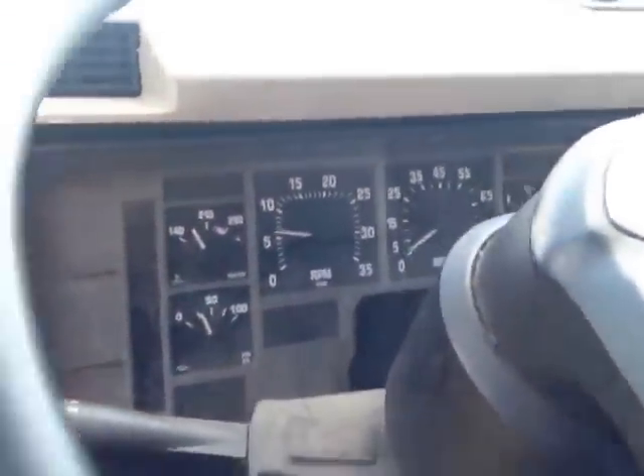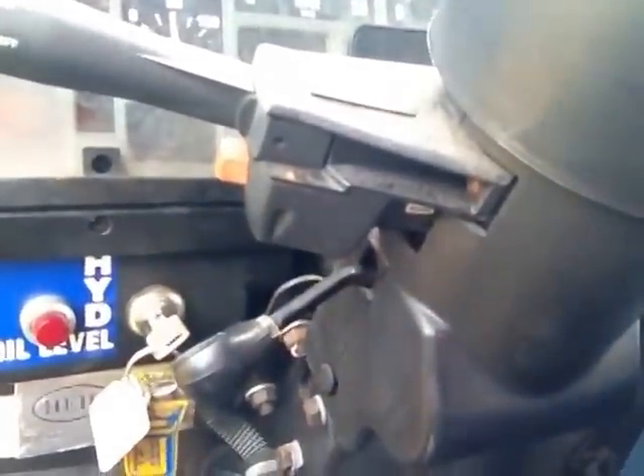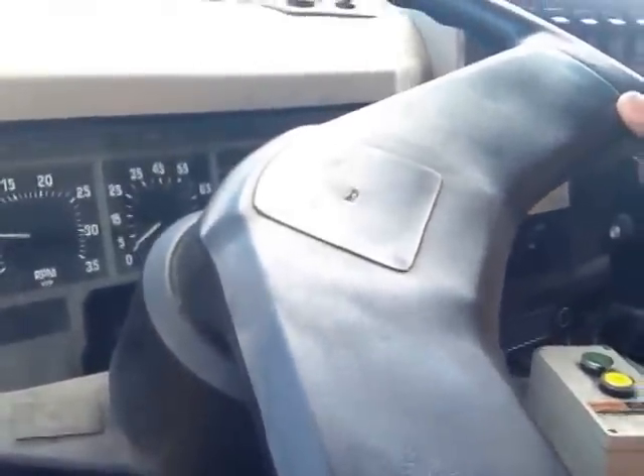Engine brake on — let's give her a rev. RPMs are up, now I let off the throttle — boom, then it kicks in. Now let's go over that clutch switch. So let's say I'm in gear — it won't kick on. When I let off, now I put it on. My foot's on the clutch just enough, just in the free play, to keep the engine brake from coming on so I can double clutch it, do a downshift, and then come off and have the engine brake again. That's the basics of the engine brake. The engine brake is there to help you drive. Once you get used to it and comfortable with it, it's kind of hard to drive without her. Tune in — we'll have another one real soon.